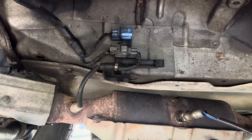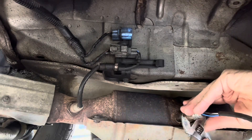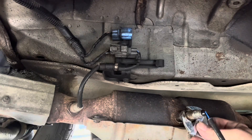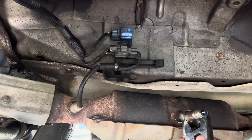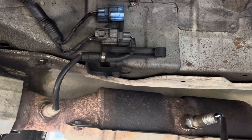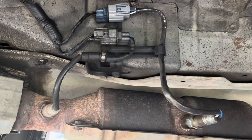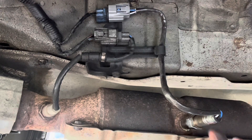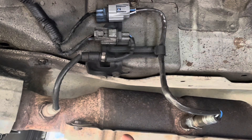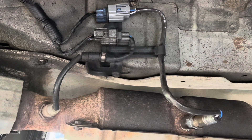It's been very interesting — I've seen some videos online where people claim that this technique is a myth and does not work. I can promise you: I bought this car, it had a 420 code, I put that defouler on it, it went away and it never came back. So why does it work on some cars and not others? I don't really know. I think the Honda being a fairly straightforward system — you've got one sensor here and one here — all you've got to do is get a difference in reading between the two. This one needs to be reading less oxygen than that one. Moving it back theoretically and limiting the amount of exhaust getting to the sensor, which is what that step-down in there does, should facilitate that.